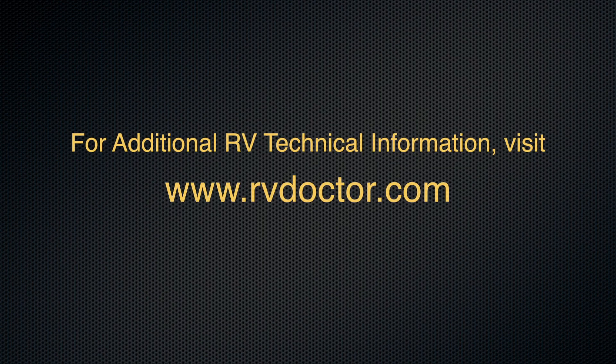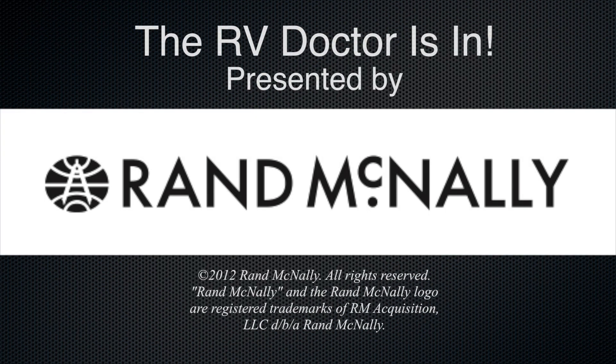EternaBond would probably work a little bit better than the holding tank patch kits available in the aftermarket. I haven't done an A-B test on that, but based on how I've used EternaBond in the past, it would probably be a good method of trying to patch — at least temporarily — your holding tank crack. But Jane, in all honesty, it needs to be plastic welded. That's the only way, with 100% certainty, to guarantee that it won't crack again. Hope this helps. God bless you all, good luck!